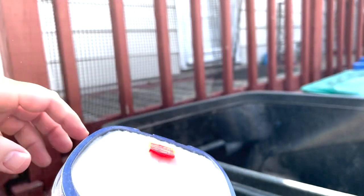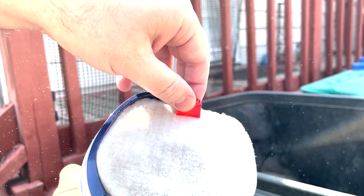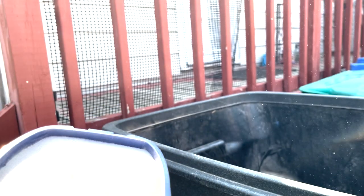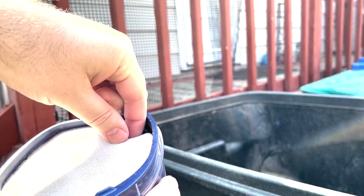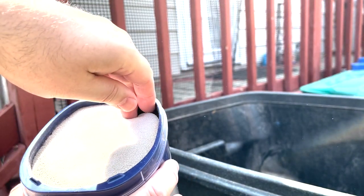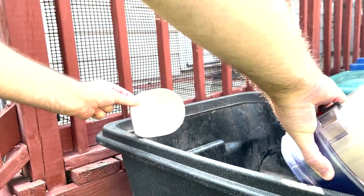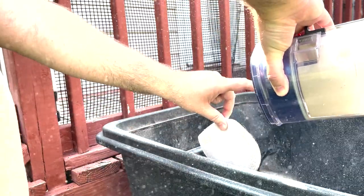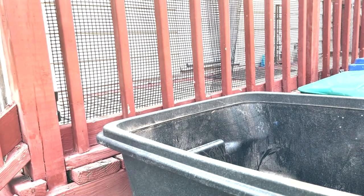There is a filter here — you don't want to pull it from the body; you want to grab it from the tag and just pull it off. There's another one we'll pull off as well. This one's going to be grimy, especially if it's been 15 months. You'll know when it's time to clean the filter if you start smelling a not-so-good smell from your vacuum — that means it can't breathe well and needs to get taken care of.